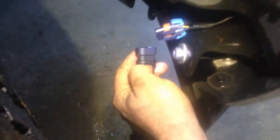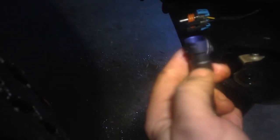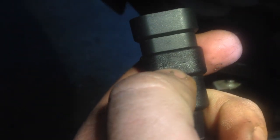Fog lights are pretty easy on this truck, especially if you got smaller hands. You just got to go up underneath this, find the bulb, turn it counterclockwise, and pull it out. Okay, and then on these clips right here, you just push this clip back like that, and it unpins. These are polarity sensitive too. Yellow wire is hot, so if you look on this connector, you'll see it with a plus sign right there. Okay, and negative. So just make sure that these things clip in.